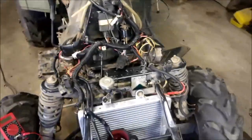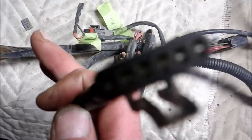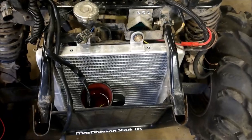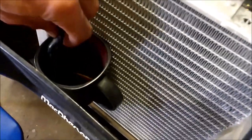I'm back with one more tip. I've got my 2004 wiring harness all hooked up — CDI box, rectifier, coil — but I've got some green wires that got corroded. Let me show you on the old one: pretty green. What I'm doing is using one tablespoon of salt and a cup of vinegar and letting my wires soak in there. That will clean all the green corrosion off. I've had it sitting for five minutes.